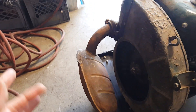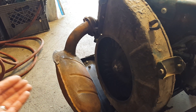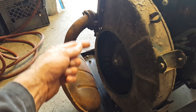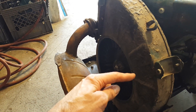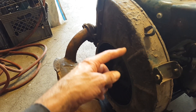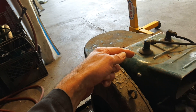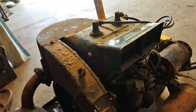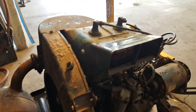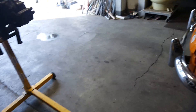On this side of the car there's a vent in the side of the fender, and this big fan draws in air. The crankshaft turns this way, and the air created by the pumping forces of the fan is blown through the top of this duct, around 90 degrees, across the top of the cylinders, and out the back of the car.